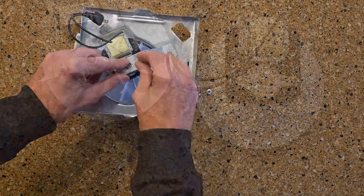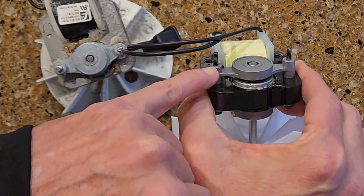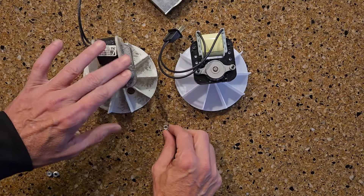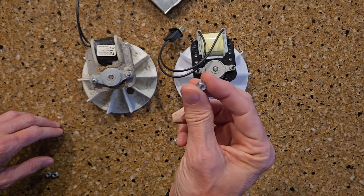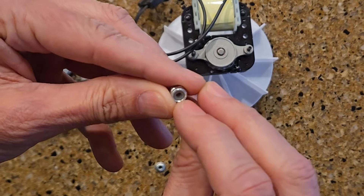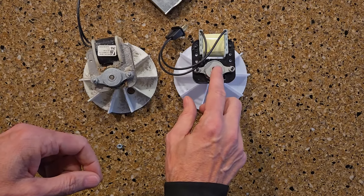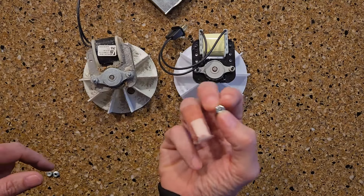I've used the same screw, but I ran into a little hiccup there. The bolts on the replacement motor are not the same size as the bolts that I took off of the original motor. These ones are size 8 and these ones are size 6, so I had to run to the hardware store real quick and pick up some size 6-32 thread bolts. I went with a compression sleeve here so that this won't loosen up over time. So if you're going to install the universal ceiling fan motor that I'm linking to down below, pick yourself up some 6-32 bolts.